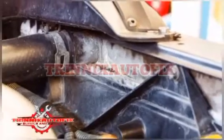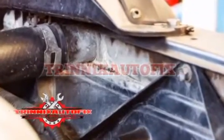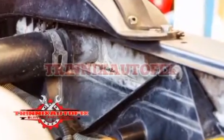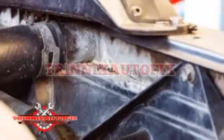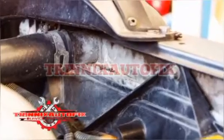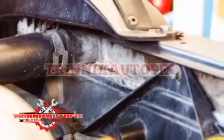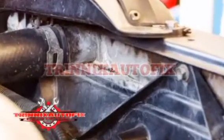1. Tighten hose clamp. It's important that all of the hose clamps are only tightened as outlined by manufacturer specs. You don't want to over-tighten any of the clamps, just as much as you don't want to leave them loose. Either situation can lead to leaks. Check the service manual for the proper procedure for your vehicle.